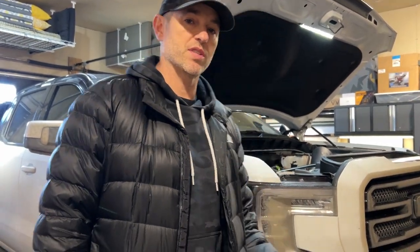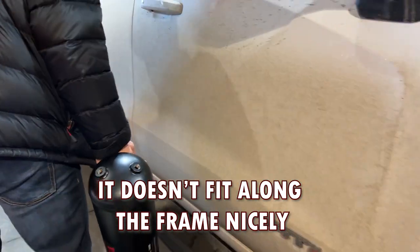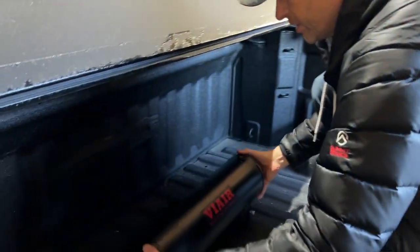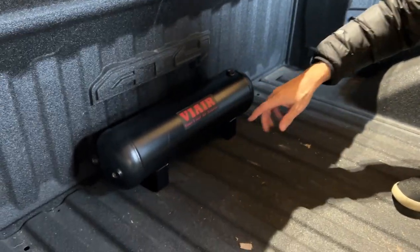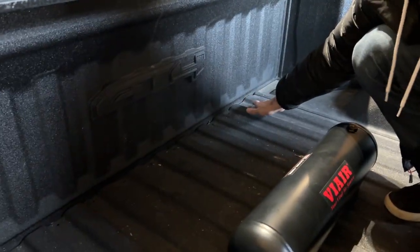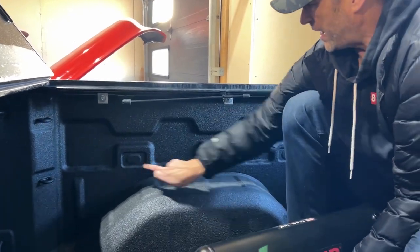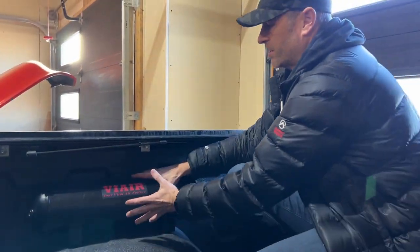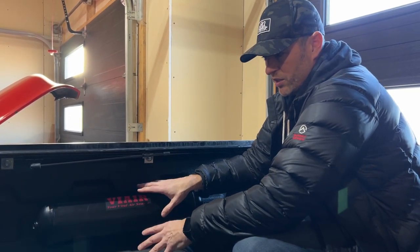The front mount is a lot harder just because of access — getting under there really isn't that fun. Alternatively, we could run a line from our current attachment down along to the bed and place the tank there. I have a couple of spots where it would fit: up at the front of the bed where the supports fit pretty well between the bed rails, though we'd have to drill some holes for the lines. But I'm actually favoring putting it over here on the side, because there are caps that just pop out — we can easily run feed lines and auxiliary lines. It's tucked out of the way and wouldn't be as cumbersome.